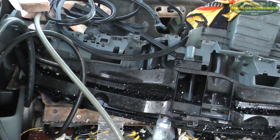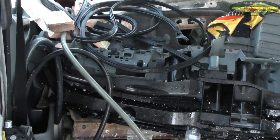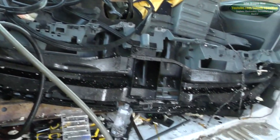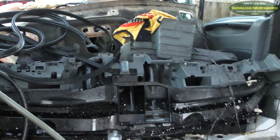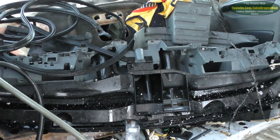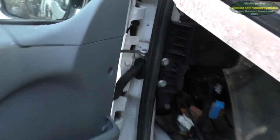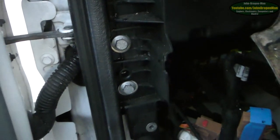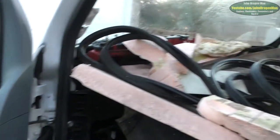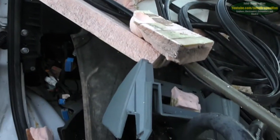The dashboard in this thing actually consists of three parts. And if you want to take the dashboard out of one of these Iveco Ecos — the Mach 4 Eco — all I can literally tell you is, if you find a screw, undo the screw. Just don't undo the bolts. You'll see there's like these bolt things here — don't undo those, otherwise you completely remove the whole cross member thing in the dashboard, the thing that your steering column is bolted to.